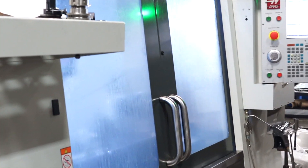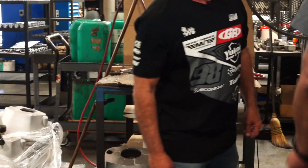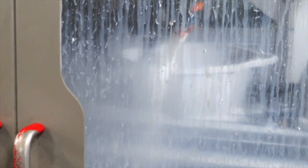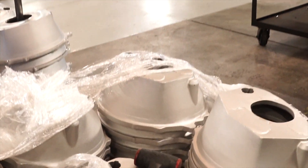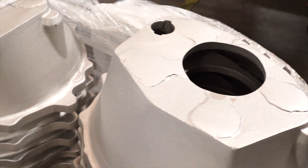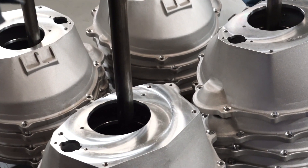If you're not familiar with it, this is common on a YJ, TJ, and LJ with a 231 transfer case — new process NP231. This eliminates the slip yoke. This is a new shaft — upgraded to 32-spline — and we'd like to say we make the best one on the market. They're making those right here — every cycle of the machine, parts come off done. We're making 400 of them. Also running right now: bell housings — raw to finished.